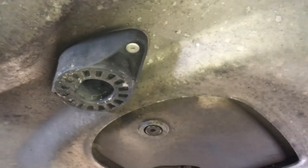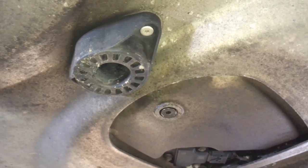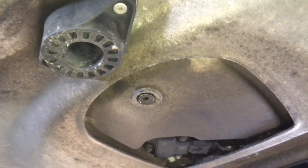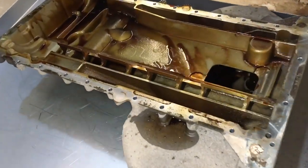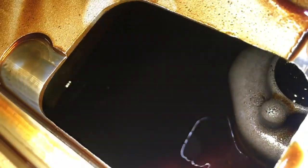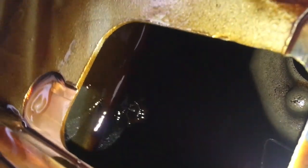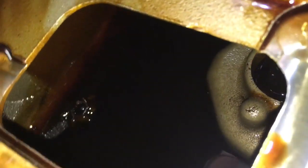We need to find a way to get that out to drain the oil, because there's 9.3 liters of oil in the sump which we need to get out first. Secondly, we need to work out a solution — whether it be a replacement sump or whether that sump gets repaired. Here's the sump: we've got a front oil drain down there that was okay, and then the one at the rear — you can just see in the distance there's still a little bit of oil in there.